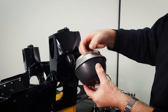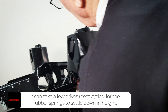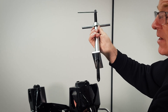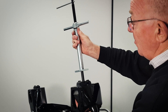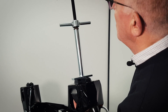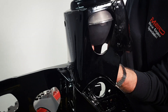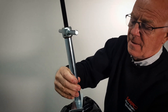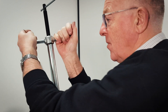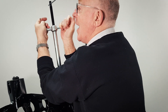This is a red dot cone which is the fast road/track day car cone. We'll pop that in sideways and twist it round so it's in position. We actually have these in stock now if anybody wants to buy one — check the website. Drop that through and wind it in to the cone. Put your finger on the inside of the cone and you'll feel the thread comes through — make sure you've got it fully engaged. Drop that onto the top of the tower and wind this down; as you wind it down it will compress the cone enough so you can get the ball joint in and the top arm.